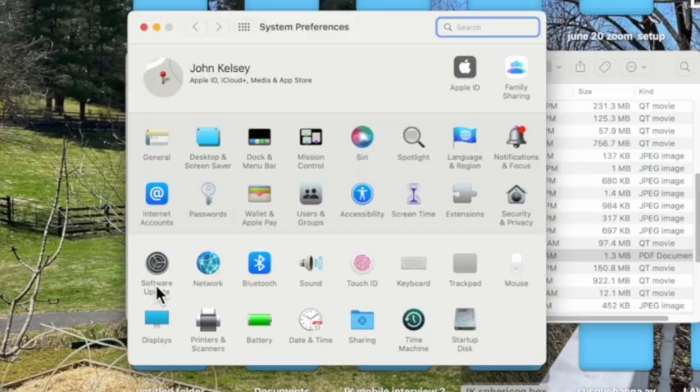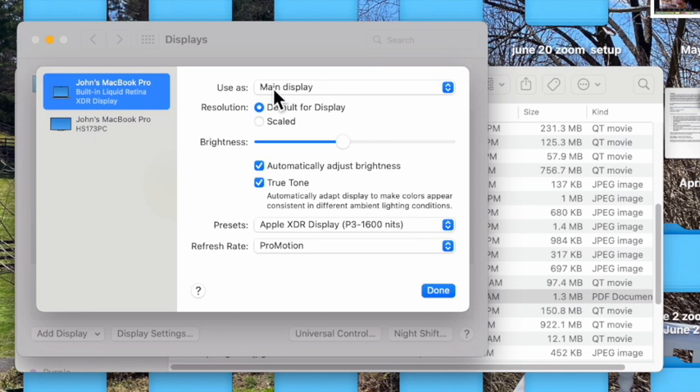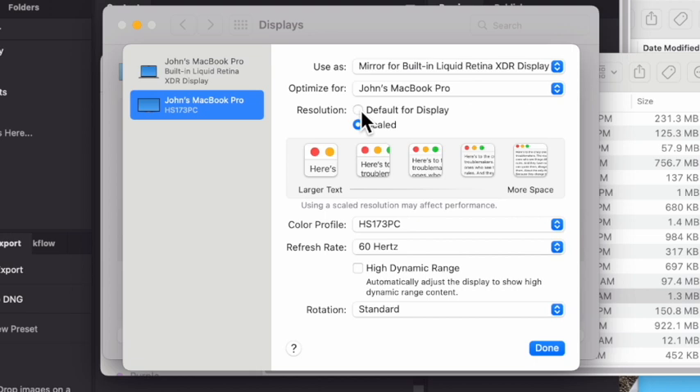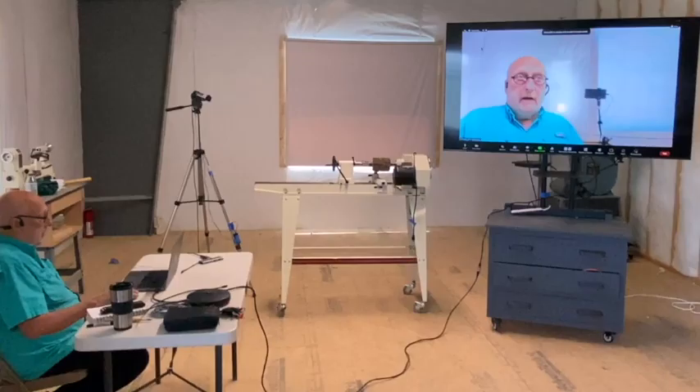However, it doesn't always work. When the big TV doesn't look right or throws your own display into some sort of chaos, the first place to look is in Display Preferences on the Mac and the equivalent set of Display Settings on a Windows PC. For the main display, the MacBook Pro, I want to use the default for display. I found that other settings just don't work. Extended display for the extra screen, I want to set it to mirror, and I want to optimize it for the main display. And I probably want to go default for display. And if that doesn't work, I'll try something else, but I'm going to start with that.